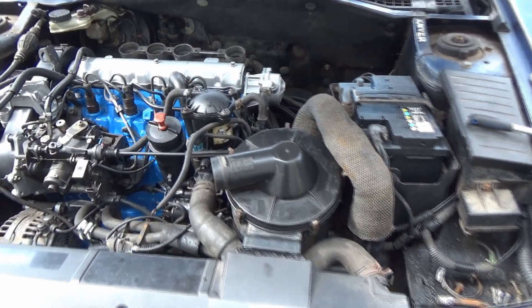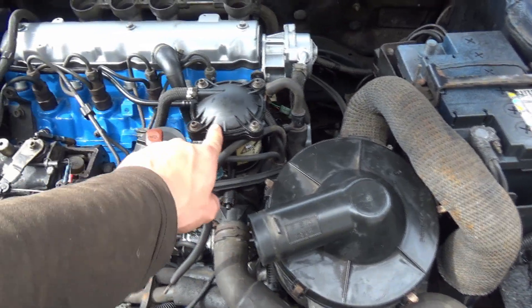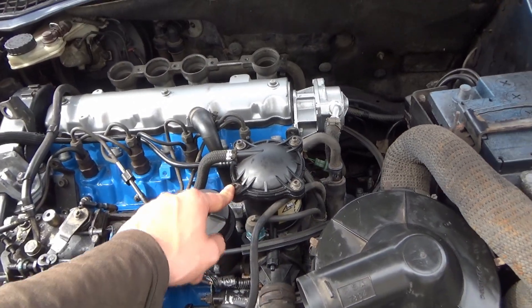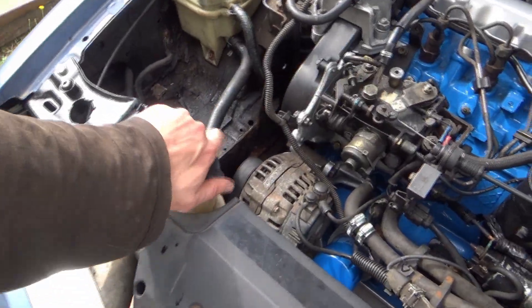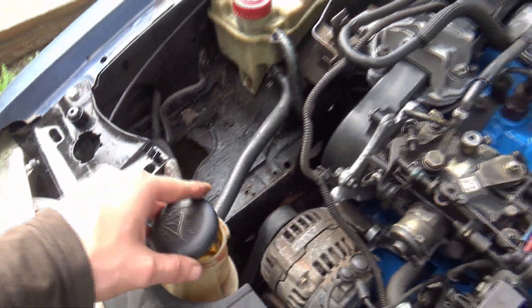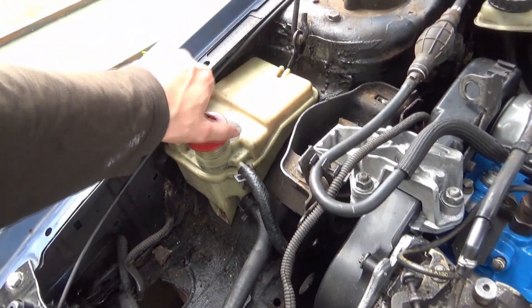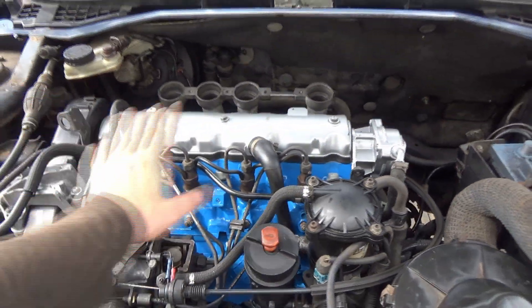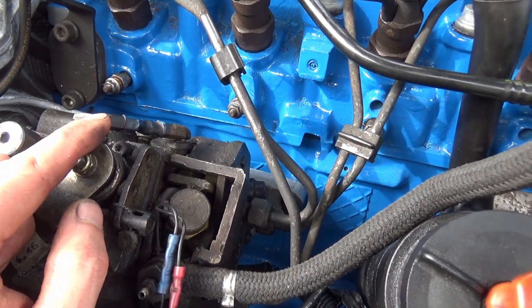It turns out that in the service video I mentioned pre-filling this — it doesn't need it, because if we squeeze the bubble just here that will prime the fuel system up nicely and fill this bowl. These are four mil hex and that's all done as you'd have seen in the last video. It's got its oil, it's got its starting amount of coolant — I might put some more in actually — it's got its starting point for power steering fluid. We've got screen wash done and the airbox is still apart because when I do the first cranks I haven't attached the glow plugs yet.